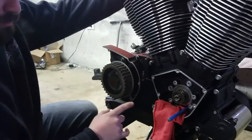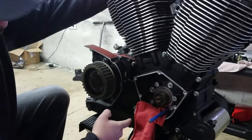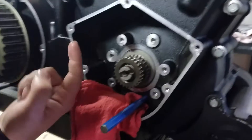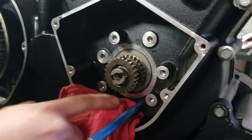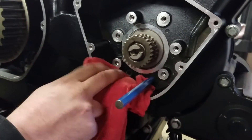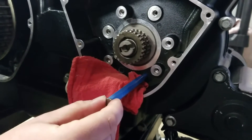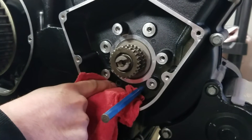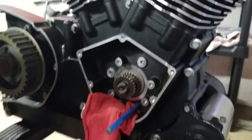In order to do that, you're going to rotate the engine clockwise on this side of the motor. You're going to see that there's a little pin here — it'll face the actual rear cylinder. That's how you know this is top dead center, along with this dowel pin. You'll see there's two holes here at the very bottom. If the pin fits into this hole, you're at rear top dead center. When you rotate it and put it in here, the front will be at top dead center.